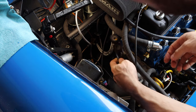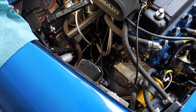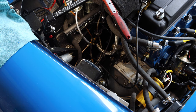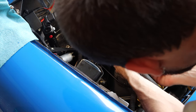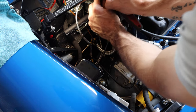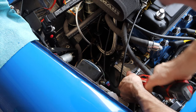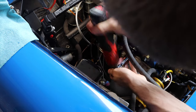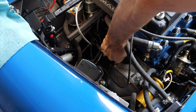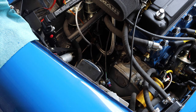What I normally like to do is install the one on the back side first — I find it's a little easier to start with the bushing end since it's a bit more rubbery and more difficult to get into place. Run that bolt through and do not go gorilla tight on that back bolt yet; I want to make sure I can get it positioned where it needs to go. Once that's in place, we can tighten everything down fully. With all of those in place, we snug up the tightening bolt, then reinstall the breather and plug up the coolant temp sensor and we're done.